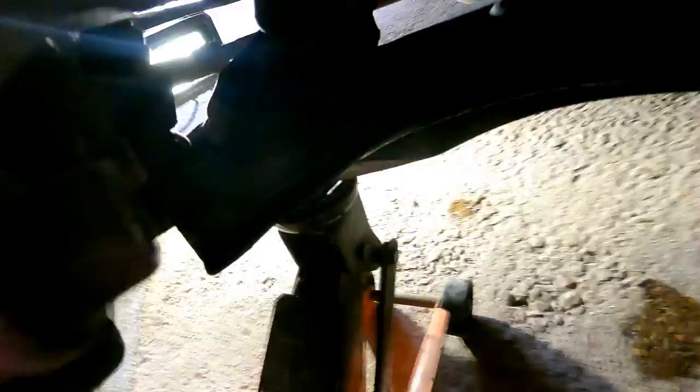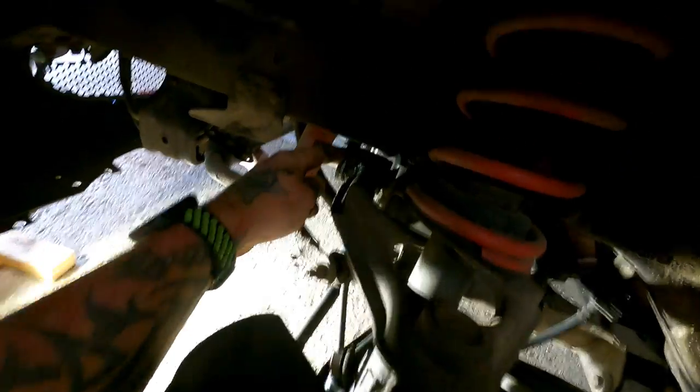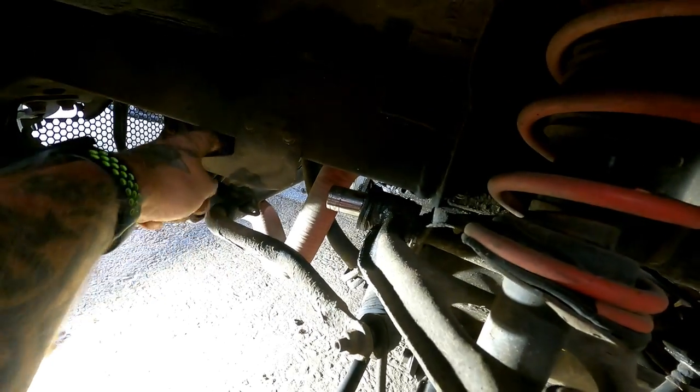Right, we've got the bottom bolt out first. There's a 21mm socket on that side and another one on that side, because that is a bolt — it's not attached on both sides. We broke it with the breaker bar, that cracked it off, and we're going to try and stick a knuckle on it. I'll hold a socket on that side and then we should just be able to get it off. You've got to take that ARB bolt out anyway, because the bolt for the upper arm goes through and that piece we're going to pull out is so long you can't get it past the bolt.